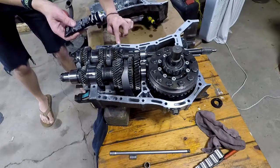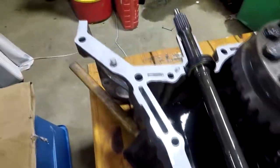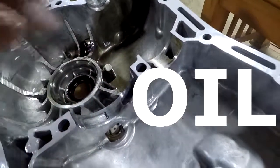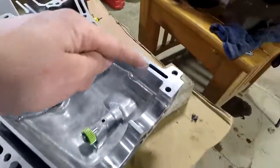I'm going to put this sealer on the cases. I got all the sealant on there and I just wanted to point out there are these little islands. You have to put sealant on them because that seals off coolant from the screw, as well as the outer perimeter — there's a screw in the center of that little island and if that leaks it's coming out the screw. You have to seal everything. The directions say to put it on both surfaces, let it sit for a minute, and then assemble.